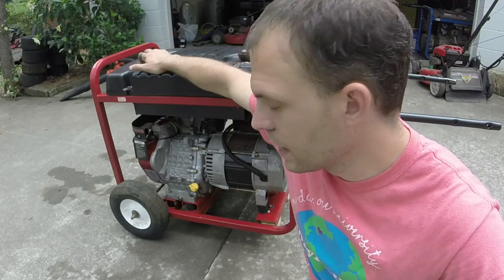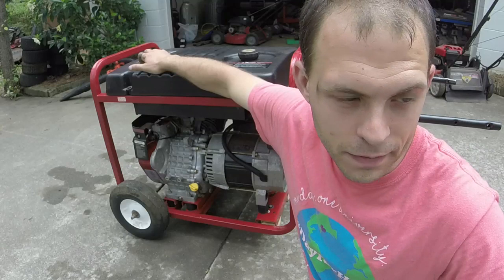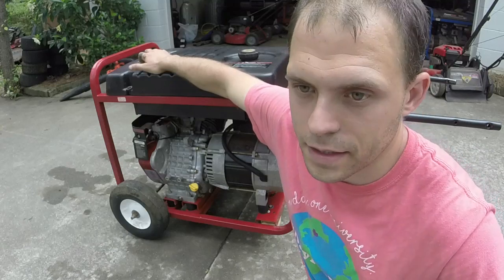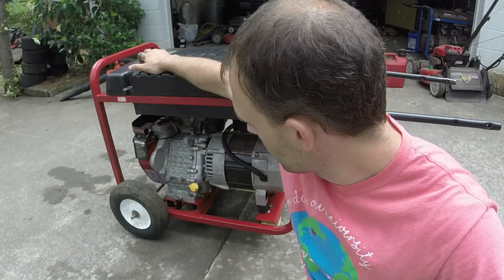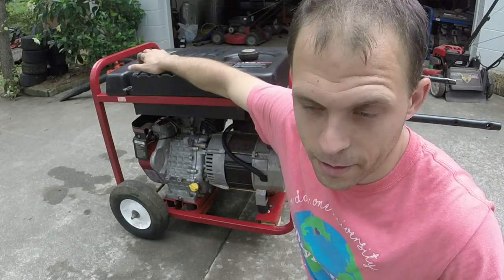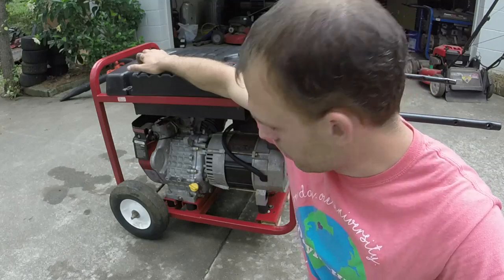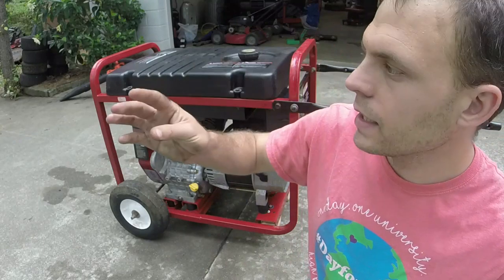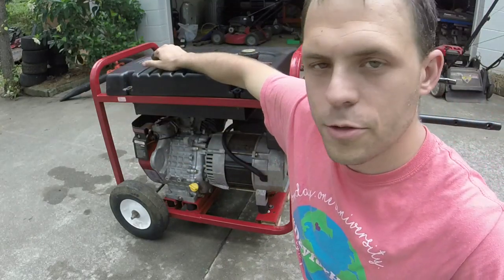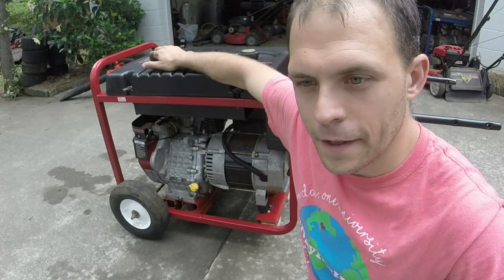I did not have as high of hopes. Obviously I buy these not knowing if the generator motor works or not. So generator motor works good. Engine now runs good with the original carburetor after we've cleaned it. So it's a win all around. We've leveled it with some wood blocks, added some handles to it, and made it a very user-friendly generator for somebody.